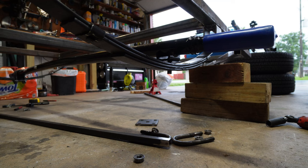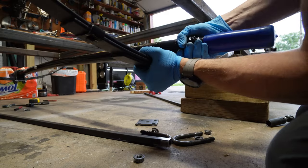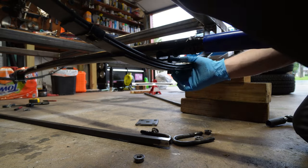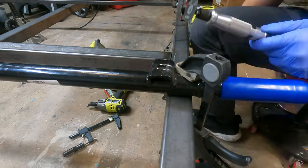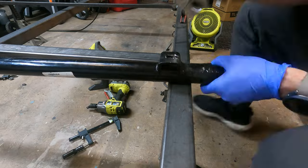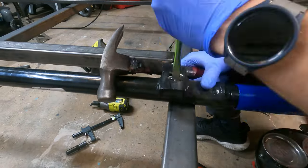After that, you can mount it to your springs, but you'll notice something — it doesn't fit. That's because my spring centers are 58 inches and my springs are 58 and a half. I tried forcing it on and it didn't seem right, so I ended up using my Dremel tool and cutting about three-eighths of an inch off of these seats so they fit better. I would recommend you buy this axle from Northern Tool because it has adjustable spring centers — it's also cheaper.